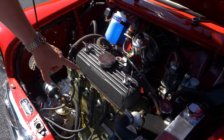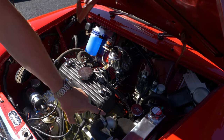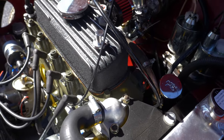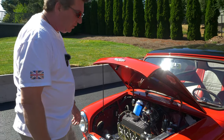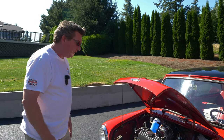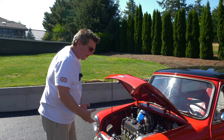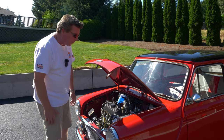You torque the cylinder head nuts down to 42 foot-pounds, but not this bolt — this is a bolt and these are all nuts, torqued to 25 foot-pounds. That'll distort the thermostat housing area if you over-torque that bolt, which is why it only goes to 25. We used all of the Jet Motors signature master kits that we've designed, including the intake single inch and three-quarter.